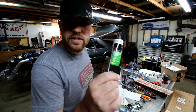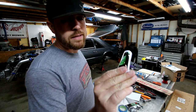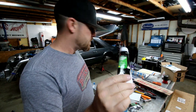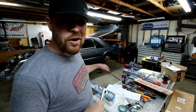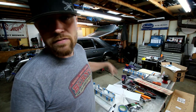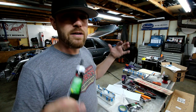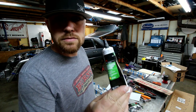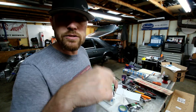There's your little secret if you didn't already know. Little yellow weather stripping adhesive, little 3M weather on your valve cover gaskets. Just glue them right to the valve covers. They'll never come off. Every time you take those things on and off, that seal will never break. And you'll be good to go. I'll link up the kind I use in the description.